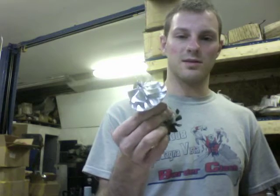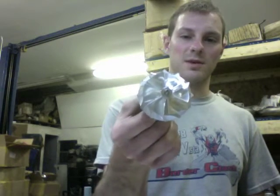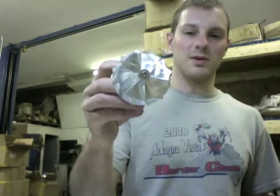I'll link to all these parts because I do sell them and also use them in my own builds. For this compressor wheel, this one is going to be a 50 millimeter wheel. The other one I just showed you is a 47 millimeter wheel — that's the 20T — and this one we call the 20T upgrade, the 50 millimeter.